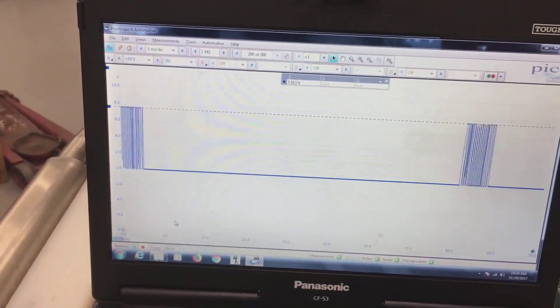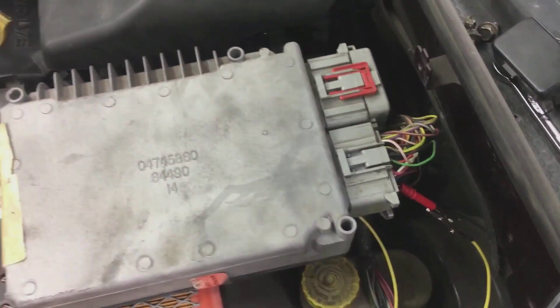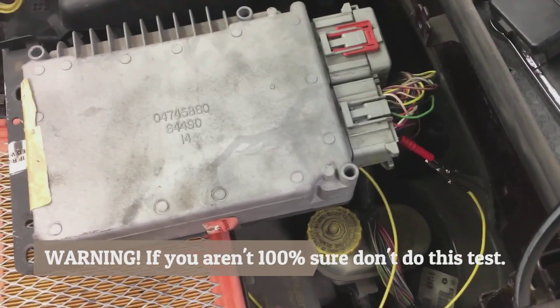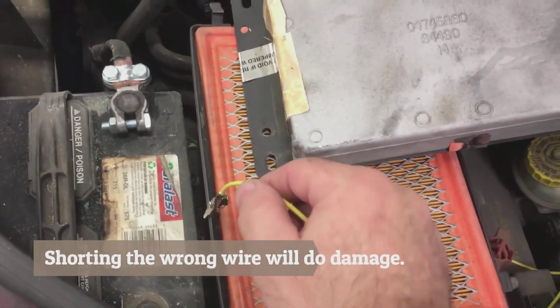We're on five milliseconds going right now. I've found my pin that goes to the computer — it also goes to airbags and other modules in the vehicle, all on the same network. This was the easiest one to access so I just came to it. It's a purple with yellow wire, and I've just back-pinned there and I've got my trusty jumper wire here.